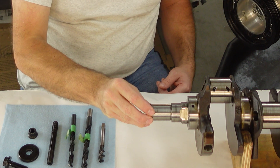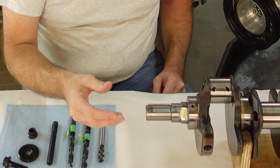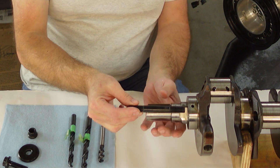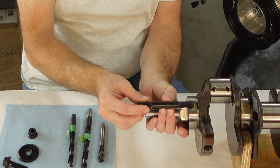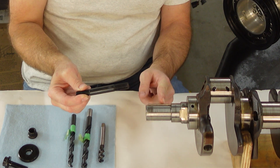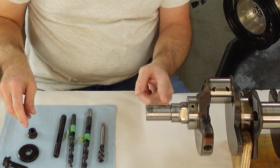It's got a little undercut on it — that's a small crank. That's where we get a lot of issues. So what we do is we drill and put this stud all the way back to here. Now we're pulling back here, not up here, when we tighten that dampener down. That's a big difference.